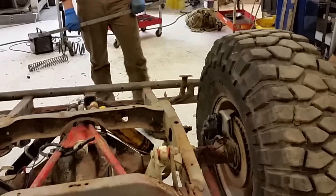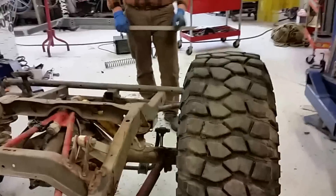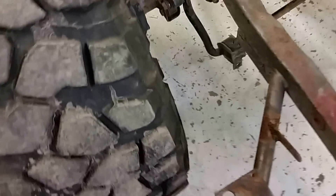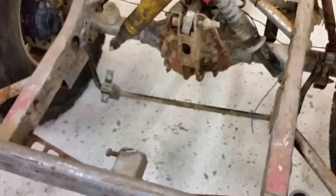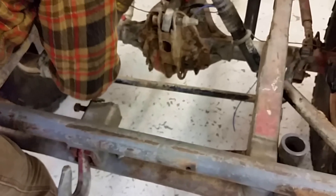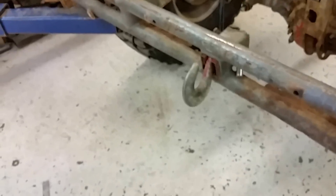If you're going to do extreme articulation, there are a couple things you're going to feed to the wolves. This is not going to be a street car. I just put a bigger heavy-duty sway bar on it — never a big enough sway bar, right Carl? Here's the other thing I discovered on that sway bar. If you look at these lengths, when it comes up, it'll go up pretty quick. Pretend we've got a sway bar here — we're going to go up. I don't think I can. It does an off-center thing and becomes useless for a second. Some of our travel is being limited.